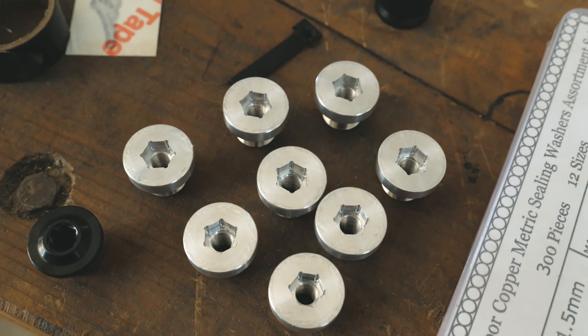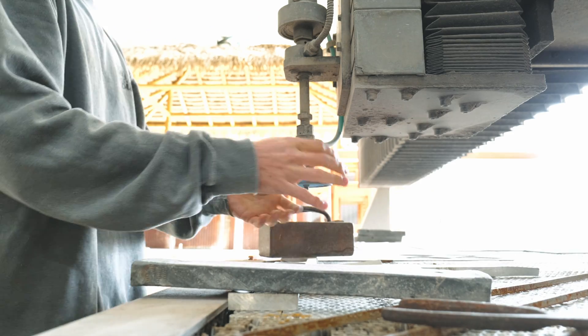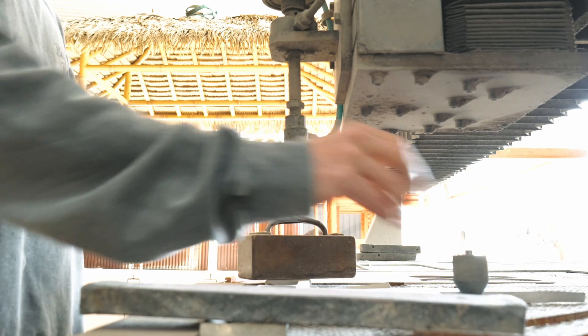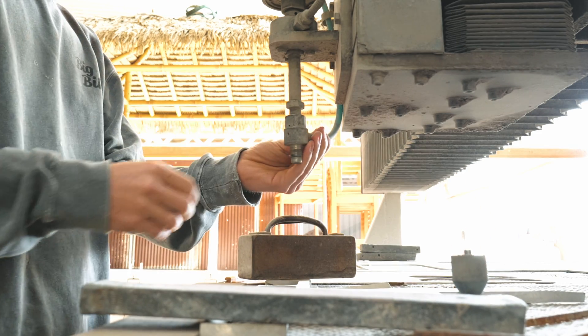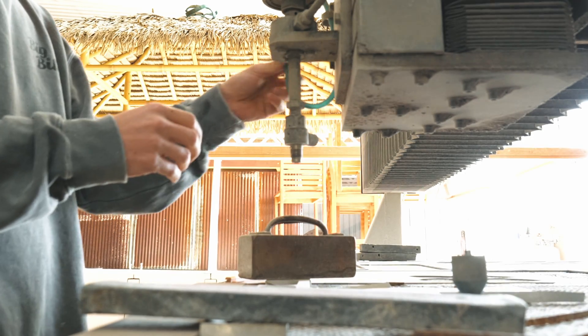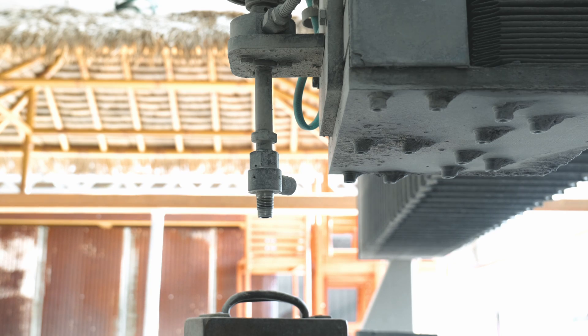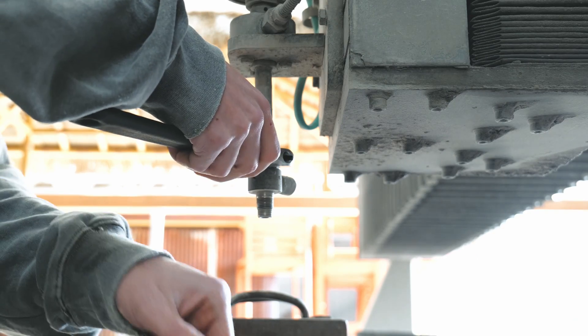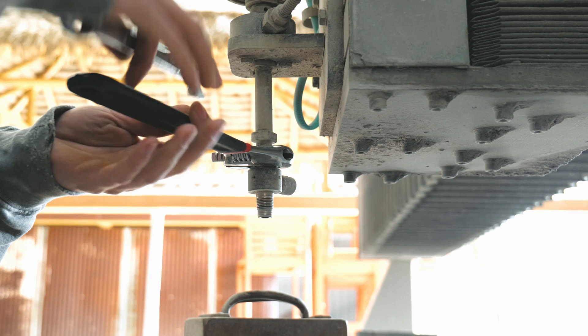While these fronts are running, I've got to cut out some rears. I cut the initial shape on the water jet first and then machine them. Before we start cutting this half-inch plate, I've got to change out the orifice — it's a little ruby restrictor. When I was cutting the three-sixteenths I could tell it was on its last life, barely getting through.